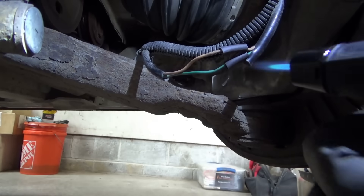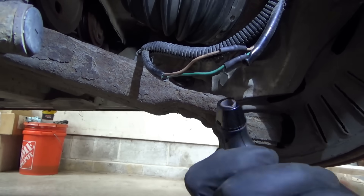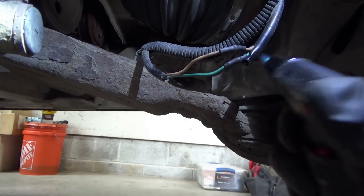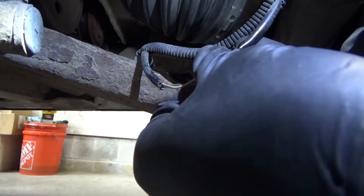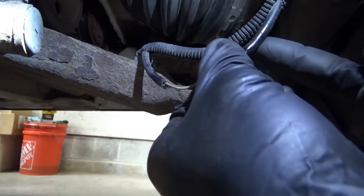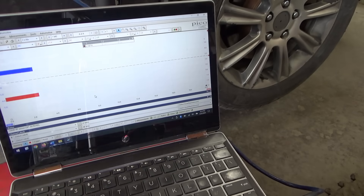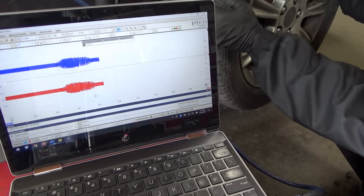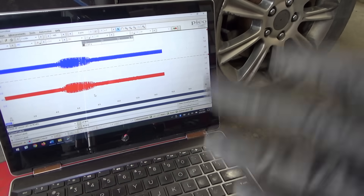Toast on the shrink wrap, wrap it up with tape — the wires are fairly flexible. Put the conduit back on, as good as it's going to get. After the wiring repair: spin the wheel, get a good signal, turn it left and right — no more problems. Customer complaint addressed. Most excellent — no parts required on that one. All he needs now is an OEM alternator.